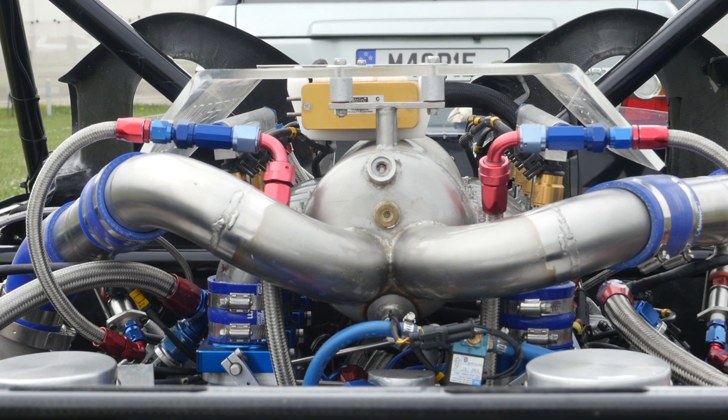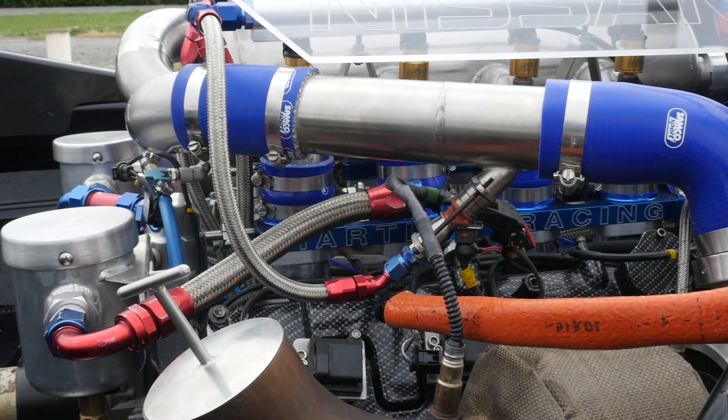It's also running on methanol fuel and there are a few reasons for this. Again it comes down primarily to weight. Running on methanol fuel, because it burns very cool, allows the engine to be run with no intercoolers, so the hot charge air runs straight into the plenum chamber.